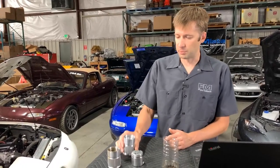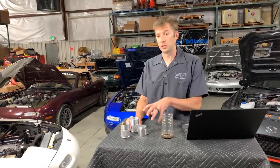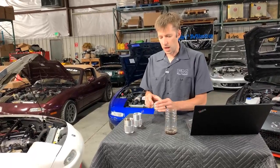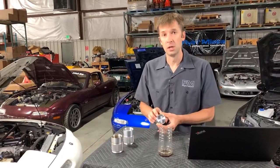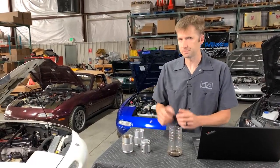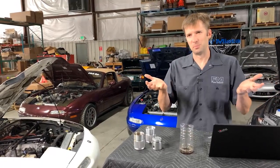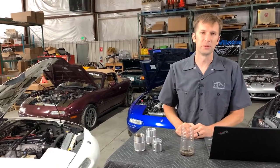Question: which do we recommend for Habu V8 conversions? Whatever fits. This Moroso kit is pretty small and easy to fit, intended for Miatas with Miata engines. The only place that matters is hose size. If you have a Habu, Moroso may have one specifically for an LS3 with different hose sizes, or you get this kit knowing you may need to replace the hose barbs and rubber hose, since those engines may have a different size. Outside of that, this will work fine. You may have to get creative with the bracketry — but that's kind of part of the deal. This engine was never supposed to be in this chassis. Should be a pretty easily solved thing with a little ingenuity and fabrication.